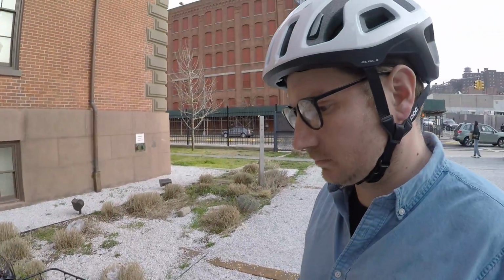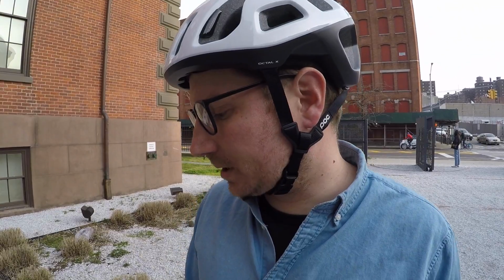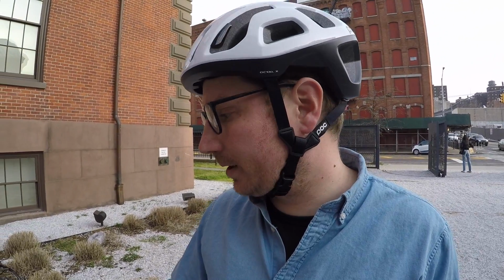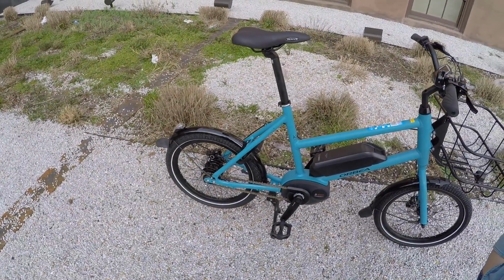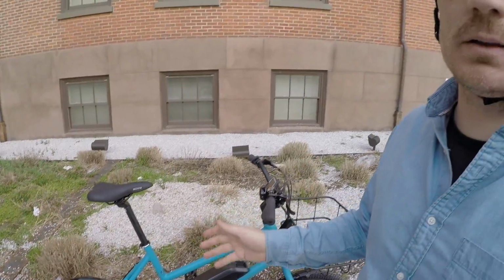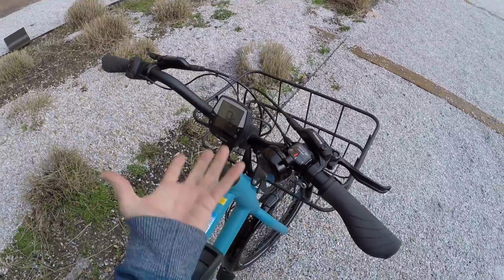And I think this year or recently they enabled it for geared hubs. Right, there's an update with the most recent Bosch update. They have a little bit better shift sensing on the hub motors, because it's definitely different than what you would normally find on a derailleur system. Yeah, so there's actually different software in there for hub motors. Well, he means internally geared hubs. Oh, yeah. But yes, that's right. That's what we're talking about back here. For hub gears, basically there's little pockets where it allows the shift to actually kick in. So that's cool. Makes it easier, but you do still have to let off the pedaling a little bit as you're shifting.